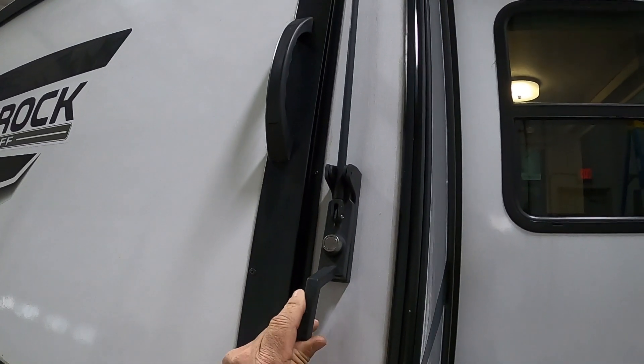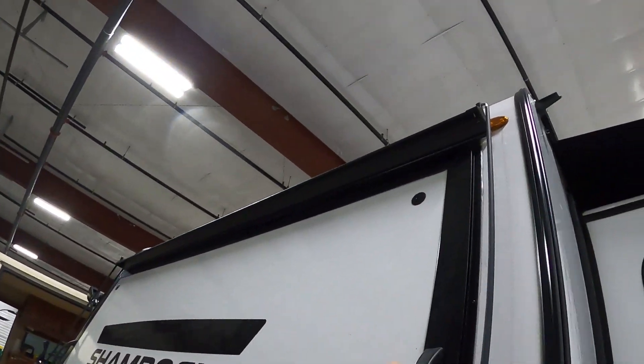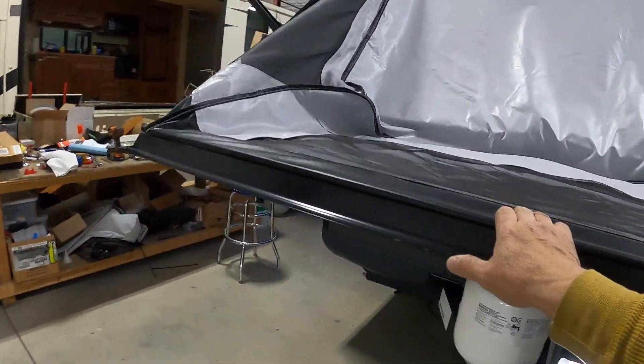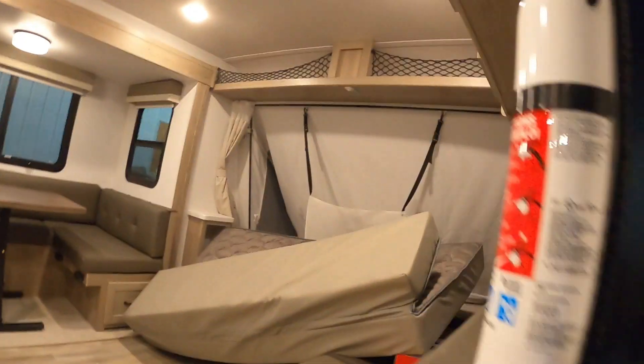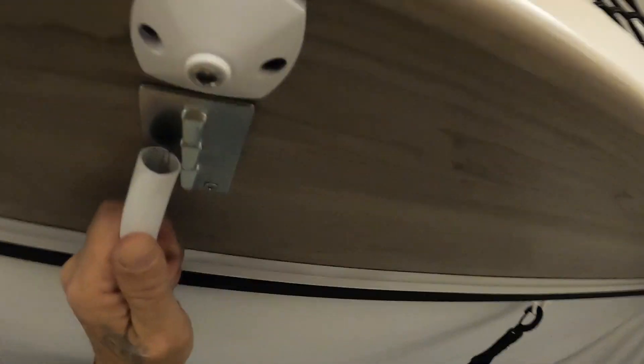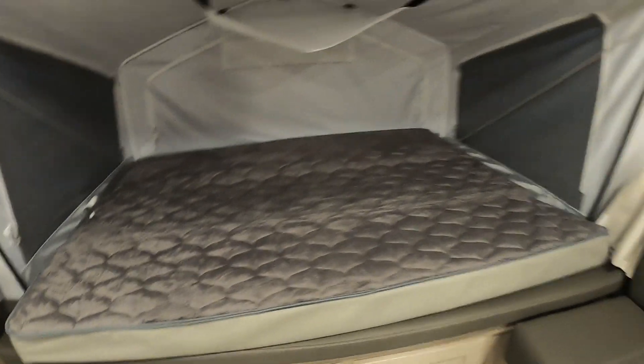Let me show you how to bring one of these exterior beds down. Make sure you keep these locked for travel. Unsnap one on each side, lift up, and simply bring it down — I do it one-handed. There's nothing to fold out; the surface is polypropylene, which is mold and mildew resistant. You've got what they call a shepherd's hook — curved on one end, straight on the other. Have the curved end up. Run it down in between the black channel area, push that out, and lock it in anywhere along the top — the tighter the better. Then fold your mattress down. That's how all those fold down.